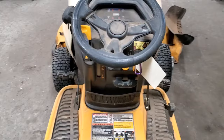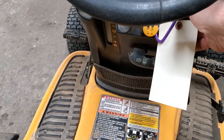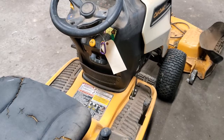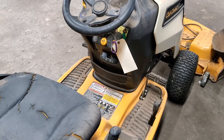Now I have the parking brake set. It has a 2021 battery in it, so I'm going to show you exactly what it's doing. See if you can hear this. Hear it click every time I do this. That tells me a couple things. Generally if the battery is dead it'll just go or nothing will happen. A single click tells me we've either got an issue with a starter solenoid or a starter.